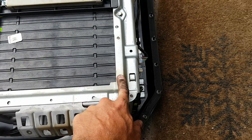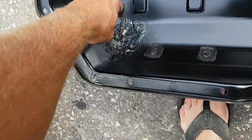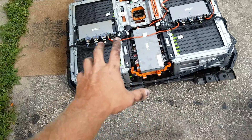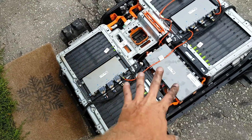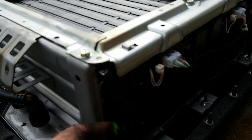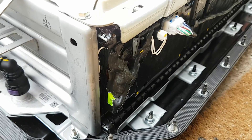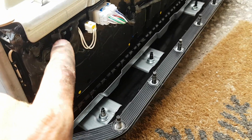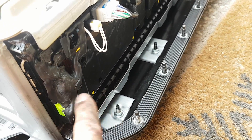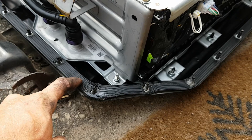We'll have to see. There's some discoloring on the metal from this getting quite hot on the inside — see how it peeled. So this wasn't a fire, luckily. A little corner might be bad, I don't know. The rest of it looks okay. Even the plastics — all the plastics over here — you can see the front cover got hot enough to melt, but only up to here. The wire didn't melt at all, so this plastic obviously melts really easy. The wires melt pretty easy too, so since they didn't melt... the gasket melted a bit.